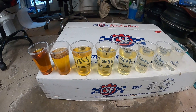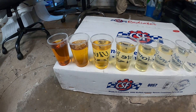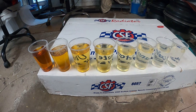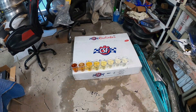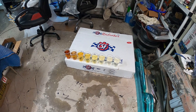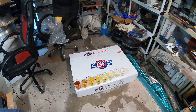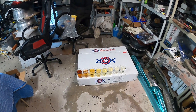Please only use distilled water — do not use tap water, drinking water, or anything else. The new coolant you use on these cars is the blue coolant; it has the right phosphorus and silicate content for aluminum heads and blocks. It's basically the G48. Do not use the G05 like people have been using — please use the G48, it's the right stuff for these cars. You can use a variety of brands; Beck Arnley makes a great blue G48 coolant, or Pentosin, or just buy from Mercedes. Do not use the green stuff that people put in their cars, and do not use the G05 — use the blue G48.